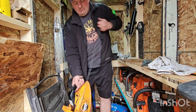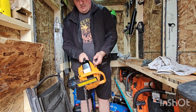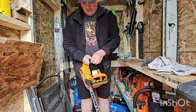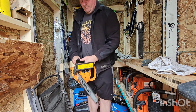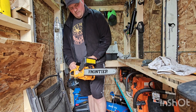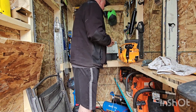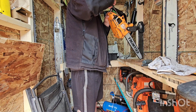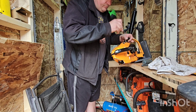There's the choke. It runs! Obviously needs a slight adjustment here — I'm going to trim the idle up a bit, turn the low jet up, cut off a little bit of the low jet fuel. We shall start.